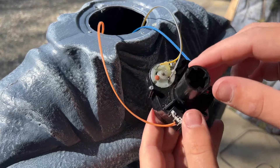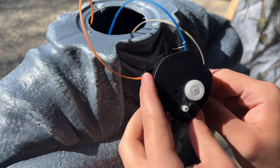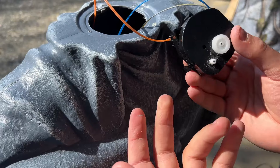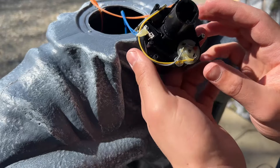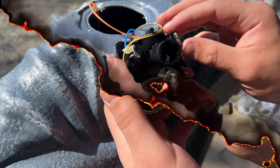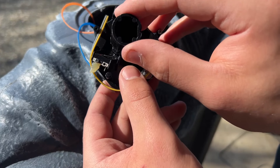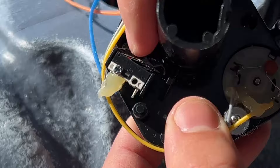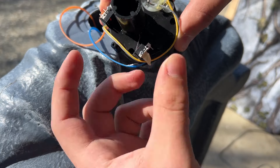So, first and foremost — hopefully this is in focus — yes, this here is just a belt that needs to be replaced. I thought it was a belt and a broken or bent relay switch, and it turns out I am correct — we do need to replace the belt, and this relay switch is really broken. This metal piece here is supposed to click this red piece, and when it clicks it, it's pretty much telling it to stop.